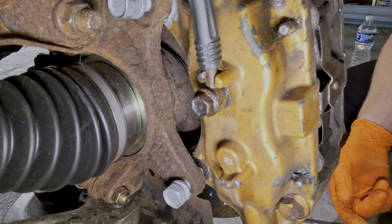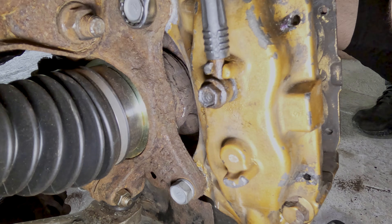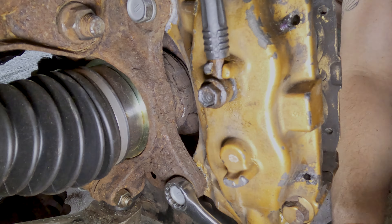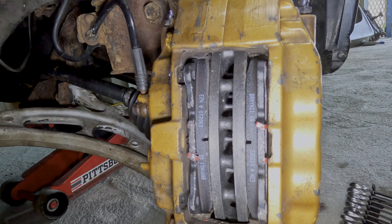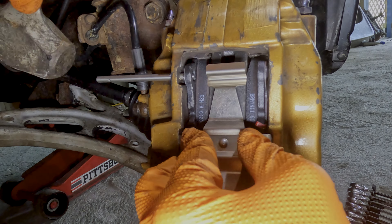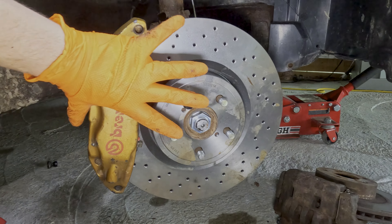With all that out of the way, you can go back to actually putting these on the car with the correct bolts and the correct caliper. I already reconnected my brake line back, so now we're just going to be mounting these directly to the knuckle. You can just install the pads and make sure you put in the hardware to keep them intact.